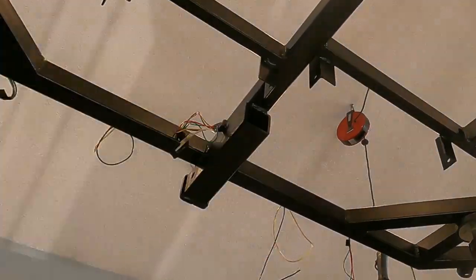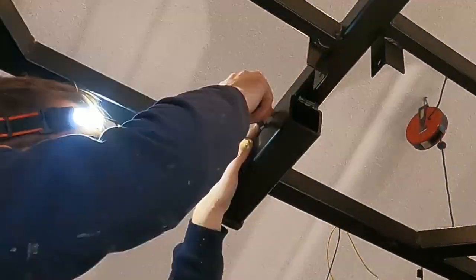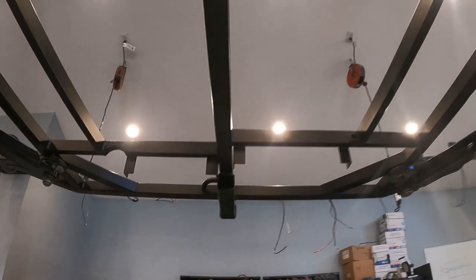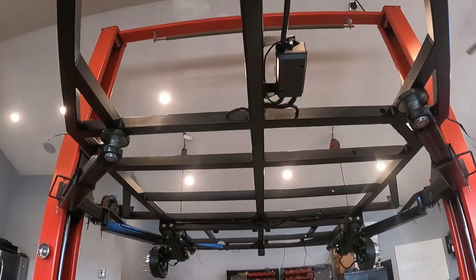I cleaned up all the wires that come out of the main center spine of the frame and go into the rear frame rail. Same thing, put some wire loom around it, clean it up, and then finish off with some grommets. Now that all the wires are done, they're hanging out the proper spots where the lights go, now we can actually get started on installing the lights all the way around the trailer.